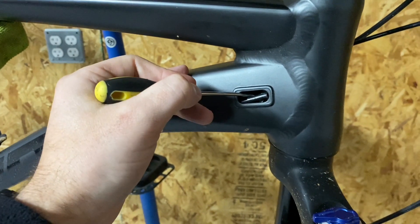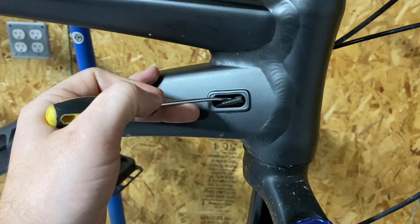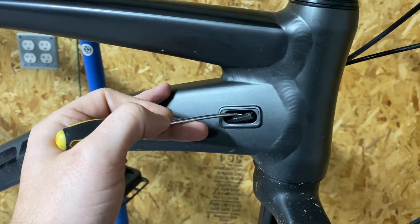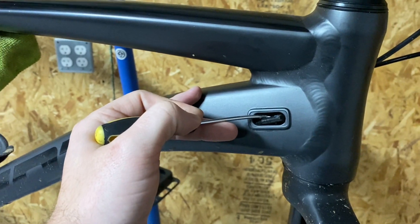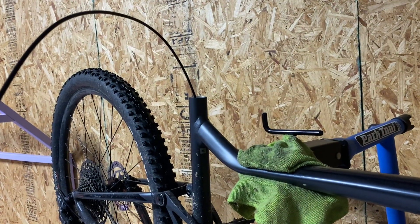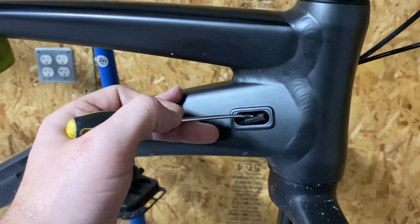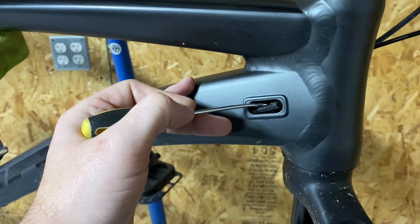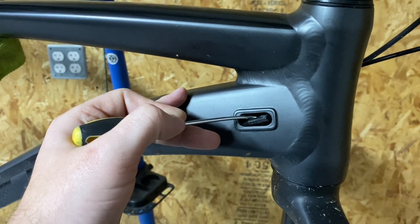So this is what I was talking about — just kind of fish it out, and then with that screwdriver just kind of pull a little bit. I'll set this back down, re-hook it, and show you kind of how to push through. Once you're here, just push on the seat tube — push on the cable and the housing coming out of the seat tube. Just push on that and it should slide right by, and we are routed through the frame. It should be a pretty easy little process. I'm going to set my phone back up on the back of my truck and push this through and show you guys how to do it.